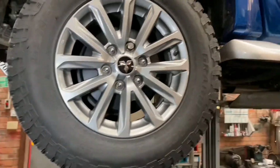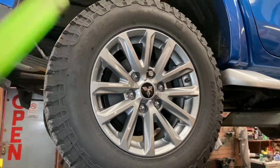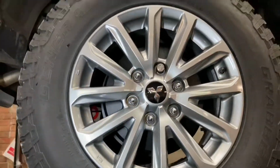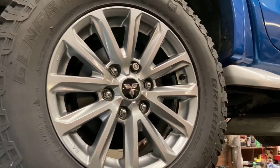And also your handbrake doesn't travel all the way up. So definitely something, if you're taking it to your garage or doing it yourself, it's an easy job. Just take the wheel off. The drums aren't even on with any screws or anything. They just pop off and you just wind a little wheel around on the tensioners, which I will show you.